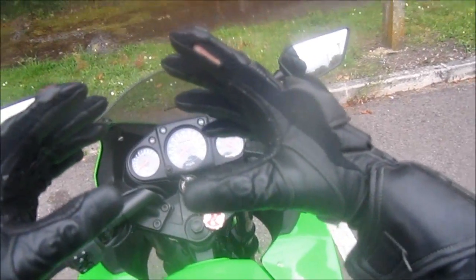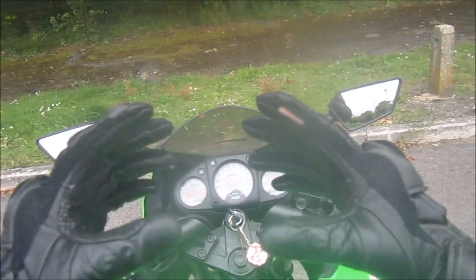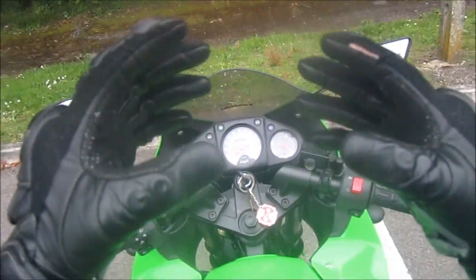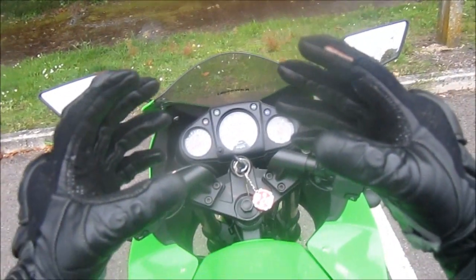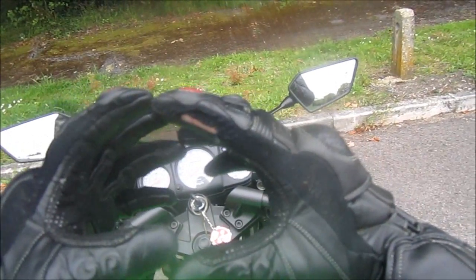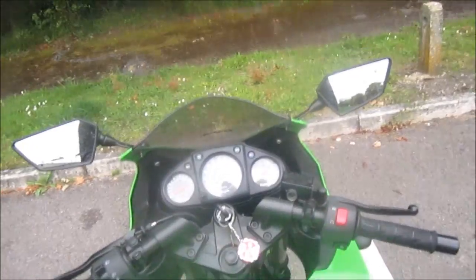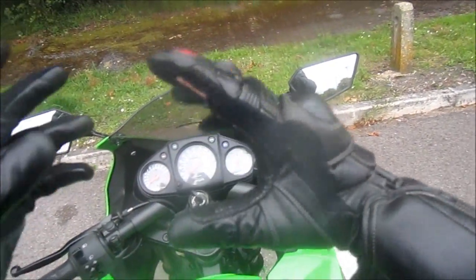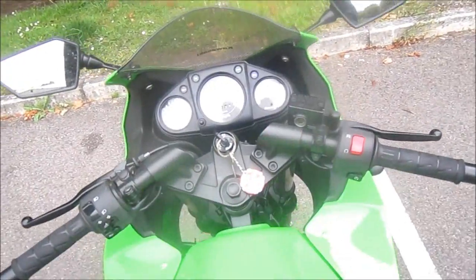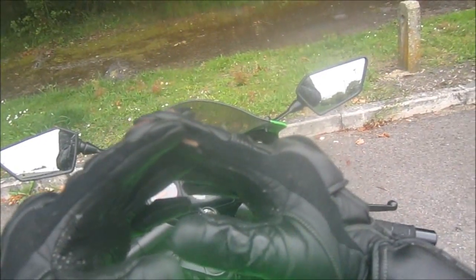So you've got to take it easy, because obviously the clutch is moving. In the case of moving off from first, from a stationary position, the gears here aren't moving at all, and the engine is. So you need to do it so gently so that you can get the gears and the engine connected and for it to spin together. So you've got the engine spinning and you've got the gears here, and you put them in together, and then they connect and they roll the wheels. So that's sort of what's known as the bite point, where the two connect.